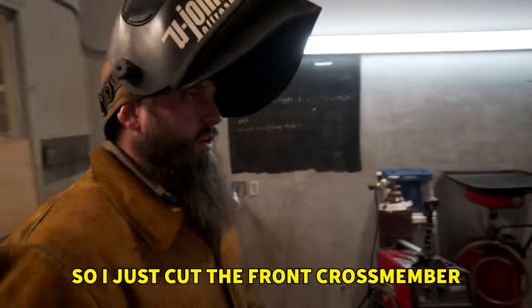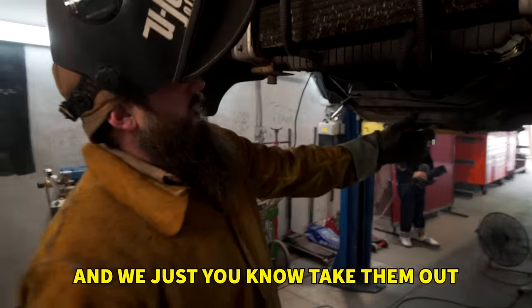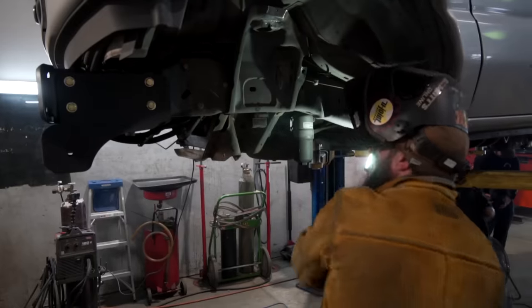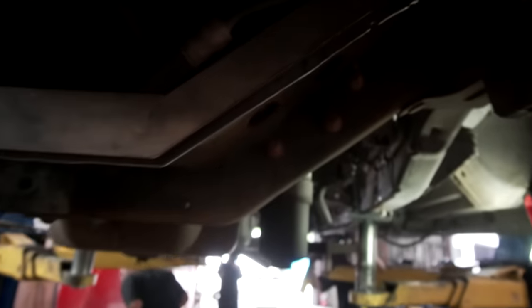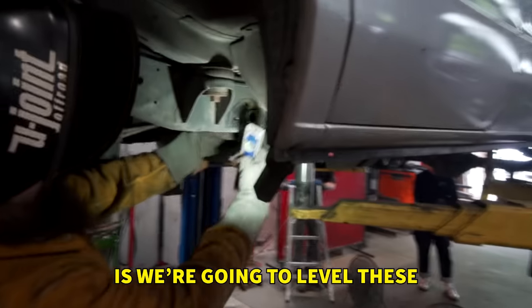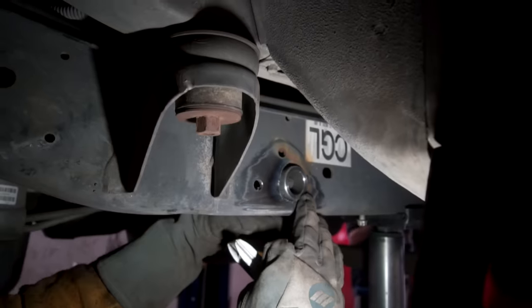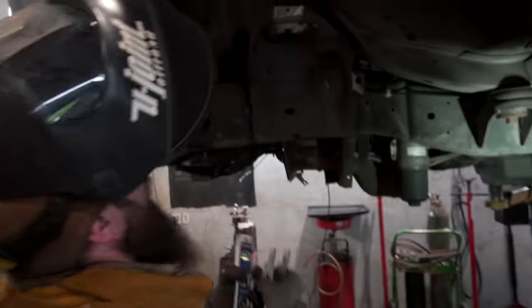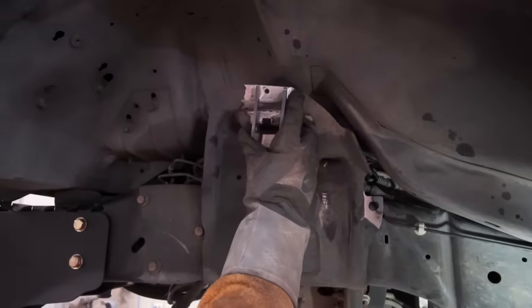I just cut the front crossmember to clear the pumpkin - just a little more clearance on the front axle. You've got a little jig here too, just so you know kind of where you're lining, and you just follow that line with the plasma. The sleeves in the frame are kicked out a little bit because the frame kicks in, so we'll kick it out to meet our spring hangers on the front side, weld those in, and then weld our shock tabs. That gives it a kick forward because we do an axle push on the front springs. How much does the axle move forward on this kit? An inch.